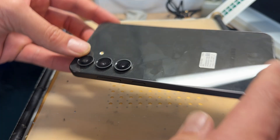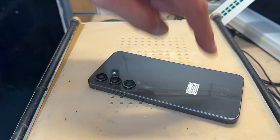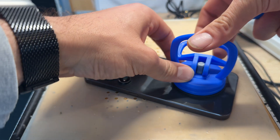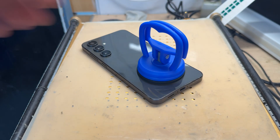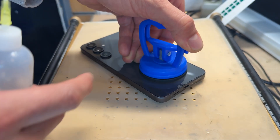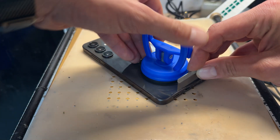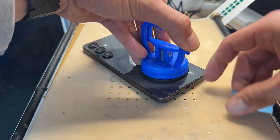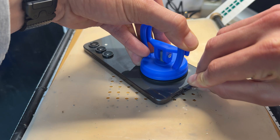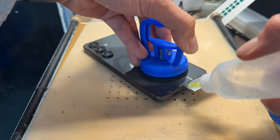For now I've had this on the hot plate at 85 degrees centigrade for about 10 minutes — it's nice and hot to the touch — so we're going to remove the back cover. I'm attaching a suction cup onto the bottom third of the device and whilst carefully levering upwards I'm going to add a few drops of isopropyl alcohol down at the bottom. We should start seeing a little gap developing; you can use a razor blade to encourage the gap to widen a little bit more. Once you've got that gap, chuck a bit more alcohol in.